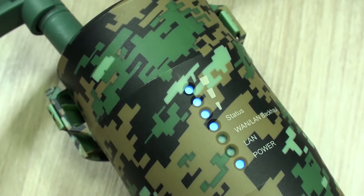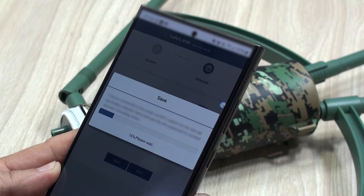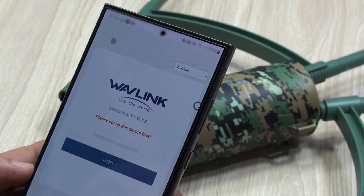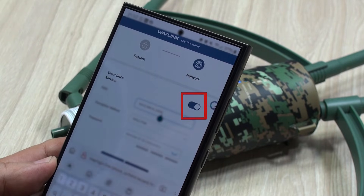Configuration is very easy — you just have to do it from a client connected to its default wireless network. I hard reset it a couple of times just for testing purposes, and both times it went straight to its configuration page. Our advice is not to leave the smart DHCP feature active, as it may cause conflicts in some networks and some clients even on the wired network may lose network access, so I would just disable it.